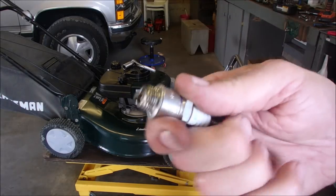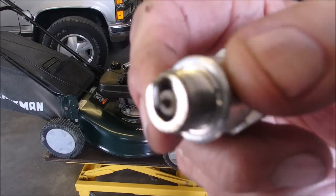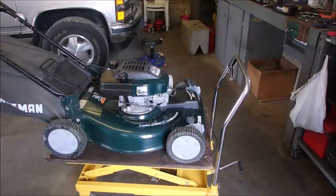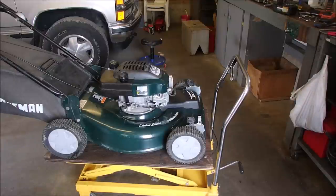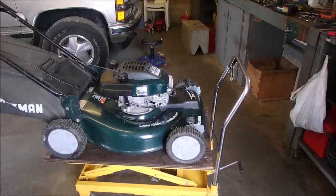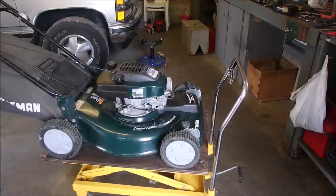So this is the plug on that. It's still hot. I didn't run it long enough, but if you look really close, it's burning white on the end of there. Not used to a flathead burning lean. I'll do a demo for you very, very carefully. But when you look at this thing, there isn't a mark on it. So something weird is going on. I'll pull it till we get past TDC. Okay, there we are at TDC. It won't even hardly go past TDC. There we go.